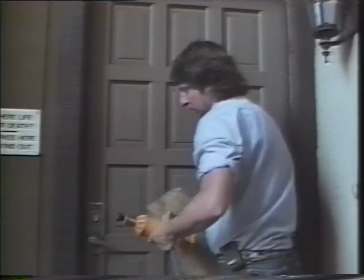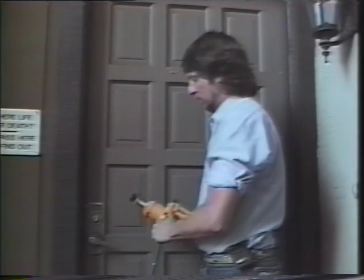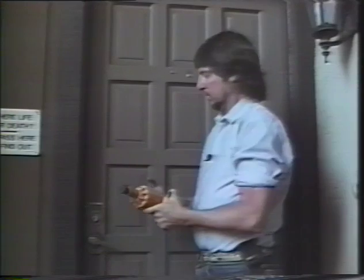Now obviously the jack isn't going to make it all the way over, so the way people did this was took blocks of wood, propped the jack up, tried to extend it out as far as they could, put other blocks of wood in front of the jack to press against the jamb. From personal experience, I can tell you this is really rough. A lot of jacks don't work upside down. The wood will bend, the wood will pop loose. It's a very cumbersome, inefficient operation.